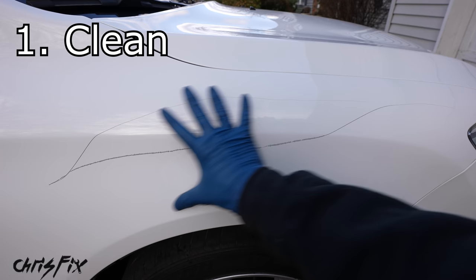For $15, a paint pen works so well. With your panel all touched up and looking beautiful, you might be tempted to add a wax or ceramic coating to protect it — but don't do that just yet. Touch-up paint can take up to 30 days to fully cure and harden, and you don't want to seal it off and prevent that from happening. In the meantime you can still drive the car, get it wet, go in the rain, wash the car — just don't seal it with a ceramic coating or wax.